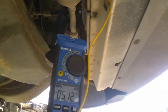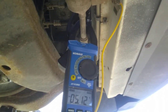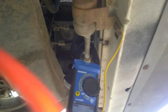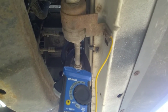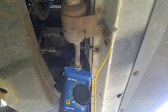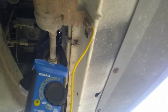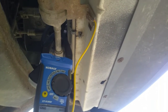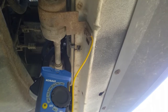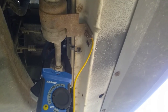Just to show you: if we're on the reference wire with this plugged in, it'll read 5.12. If you're reading 5.12 on both sides, either you have a bad pressure switch or the pressure switch pins are not making contact with the sensor. That's a good way to troubleshoot it. But we're reading 5.12 on the reference and about 1.5 on the sensor wire, so that lets me know our wiring integrity is good.